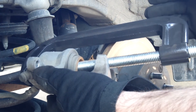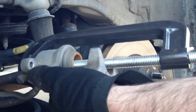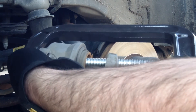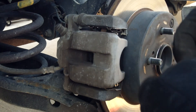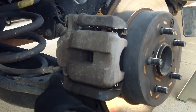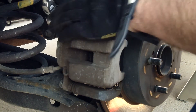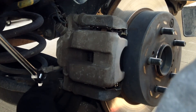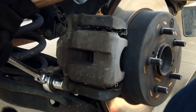I got my 8 inch clamp on this end, and the screw-down piece actually goes right into it nicely. Just start turning the caliper piston back. Time to go ahead and put the bolts back in — there's the top one, there's the bottom. Got my 3/8 ratchet here with my 14 millimeter socket. This one is a pain. Just snug it up — both bolts snugged up.